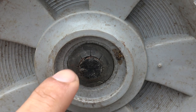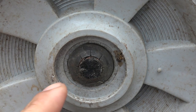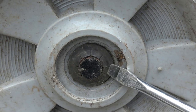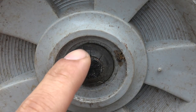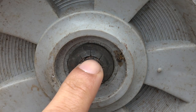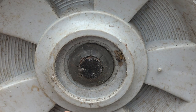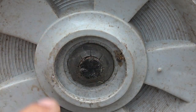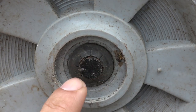This ring is what retains the wheel in place and it only goes in one way, and that is in. If you try to pry it out with a screwdriver, it will just get tighter and will never come out. In the past, I used to use a dremel tool and cut out one of the teeth here. But that's tedious work because I have to be careful not to cut into the plastic of the wheel. And after I cut it, this ring is not reusable.